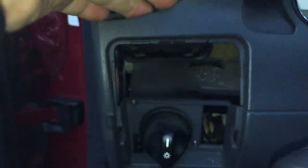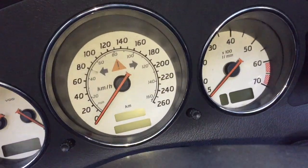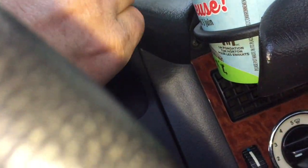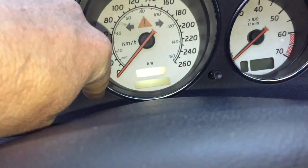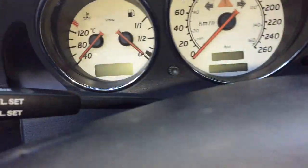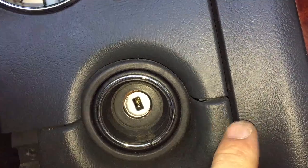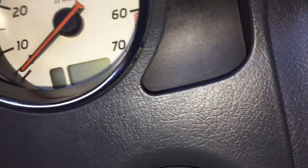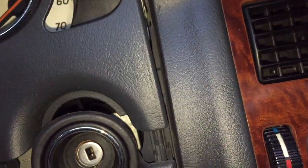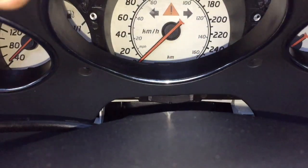Pull up — see that little pin? You've got to slide over, then stick your fingers under and start popping along the edge. Now carefully watch the dimmer and clock buttons — you want to pull up. The panel will separate along this line and along this line; there are little tabs in there that will separate, so be very careful.